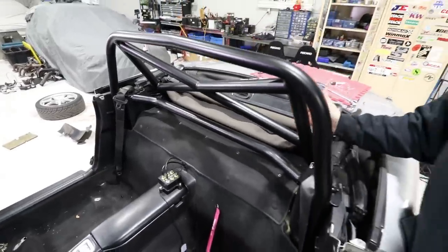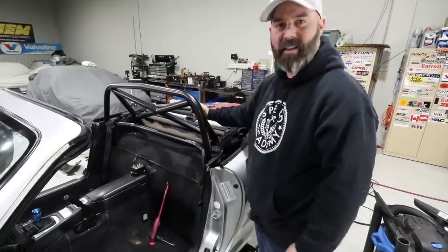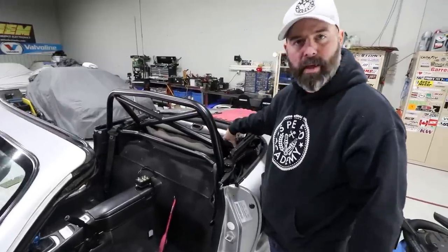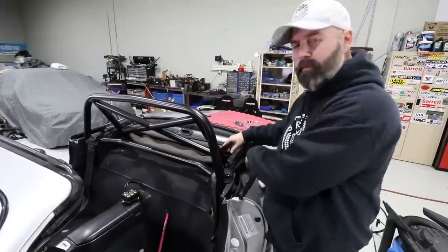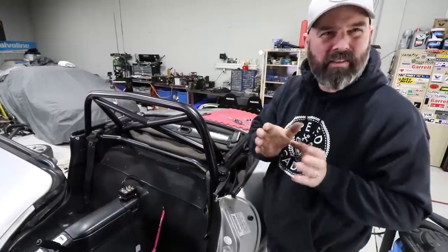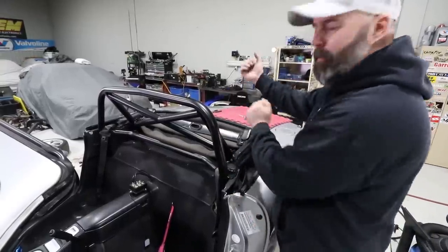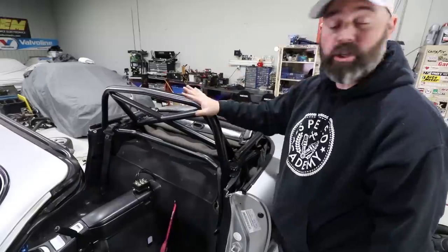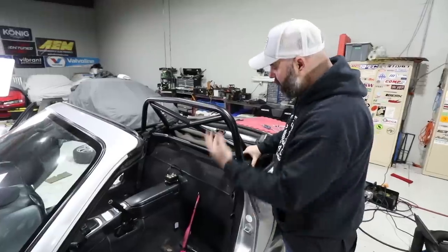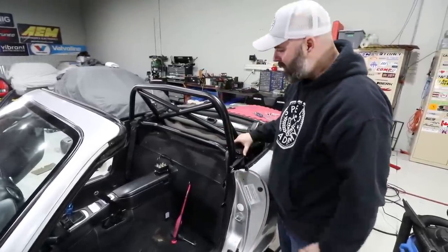The install is looking good. I am stoked on the safety upgrade and the chassis stiffness upgrade we've just made by installing this bar, and all in all I think the install went very well. I think we could have trimmed less sheet metal out of the back area for the rear arms — they recommended cutting out a fairly large area, like 5.5 by 4.5, but we could have done like a 2 by 1. They probably recommend that just to ease installation. Frankly, we've added so much chassis stiffness from this that cutting out a bit of extra sheet metal back there will have no impact whatsoever. The carpet fit in beautifully — I love how OEM it looks. We had to do a couple of little relief cuts back there to make it sit nice down, but it looks great.